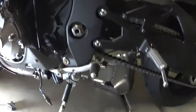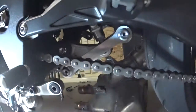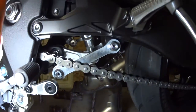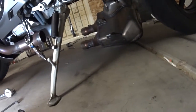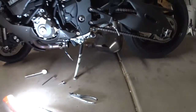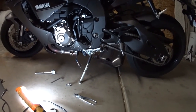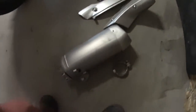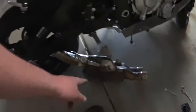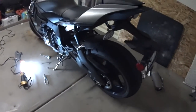I'm on to step two — I ended up having to remove that big catalytic converter to get to those dog bones right there. Those two silver things that look like dog bones are what we're going to be taking out and replacing with the turnbuckles. Since I've got the exhaust pretty much entirely removed, I wish I had an aftermarket pipe to install right now instead of putting this all back together, but I don't have one yet. Look at the size of this catalytic converter — this thing's got to weigh like 25 or 30 pounds. And the bike just doesn't sound that great with the stock setup.